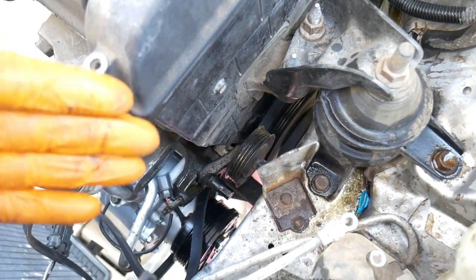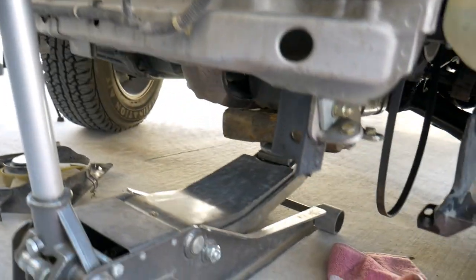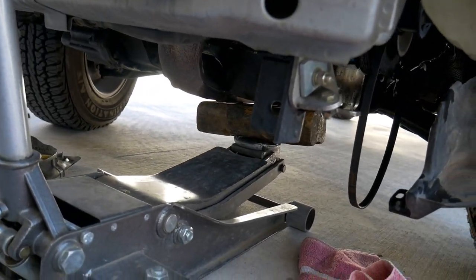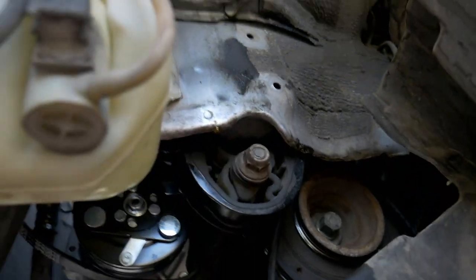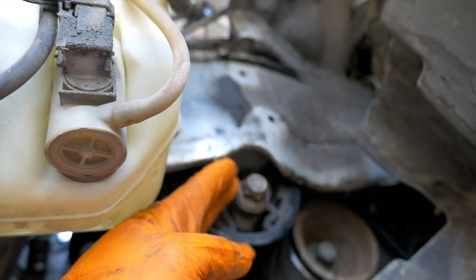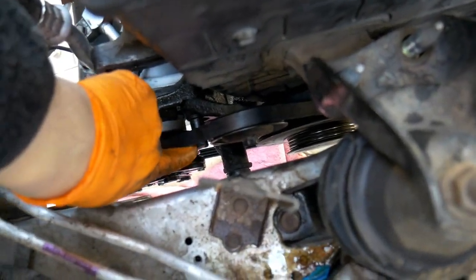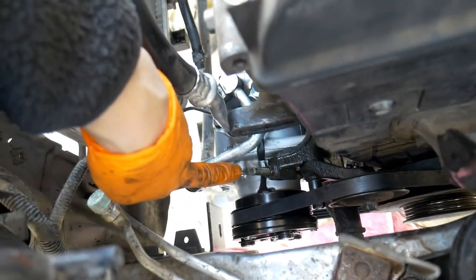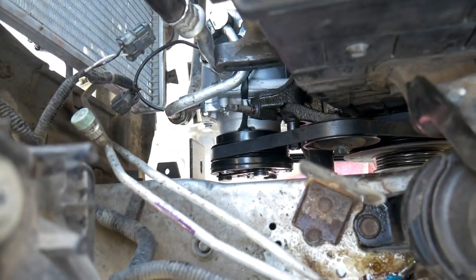To get the belt on we need to lower the engine and remove the torque mount — remove these two 17mm nuts. I also have the engine supported with a 2x4 between the header and exhaust manifold to spread the weight evenly with my jack. There are two 17mm bolts on the side of the torque mount. Getting the belt on didn't actually require me to move the torque mount nut — I was able to just slide it up once the engine was lowered enough. The tensioner is a 12mm nut and a 7mm, and I got that tensioned correctly.